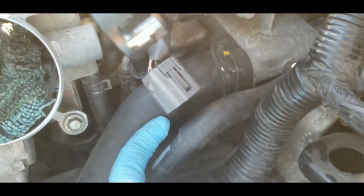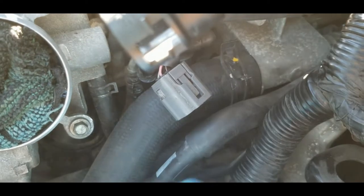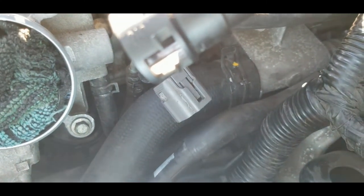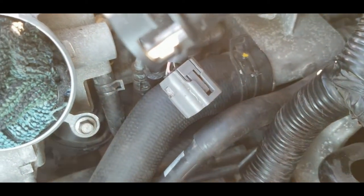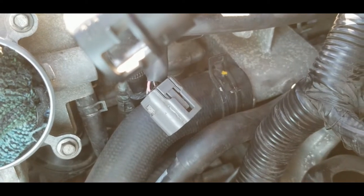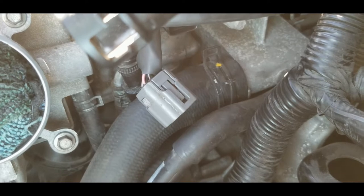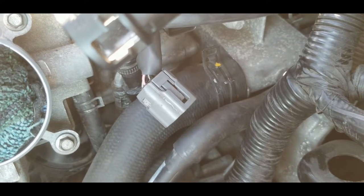So expect that the coolant is going to spill after removing that. So make sure that you have a container underneath, and make sure you hose down all the remaining coolant that is spilled on your driveway, because it's poisonous for pets like cats and dogs. The coolant is sweet, so dogs and cats might lick it,